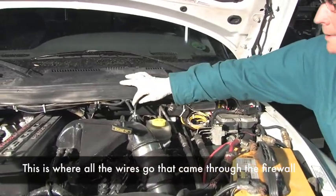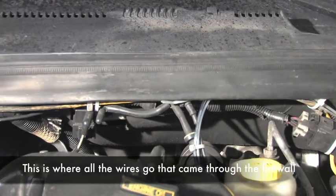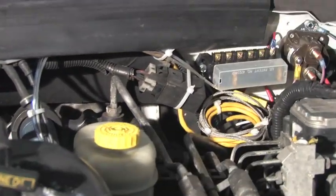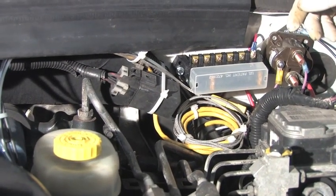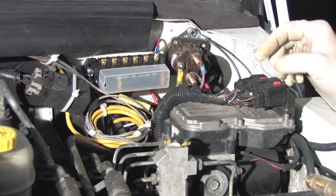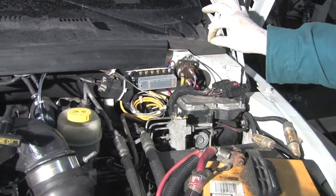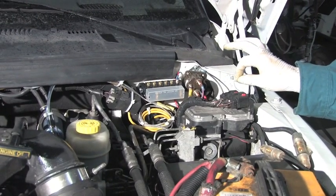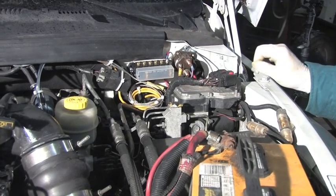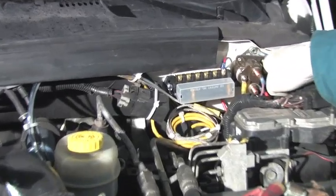Okay, we've now connected the turbo boost line to the in-dash controller. We've connected the thermocouple with the K connector. The white wire to the pump red power wire underneath. We've connected the red wire that came from the controller to a keyed source with a 25 amp fuse, and connected the black wire to an excellent ground location, as you can see above.